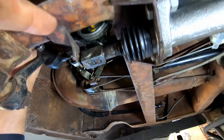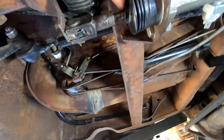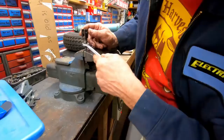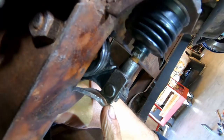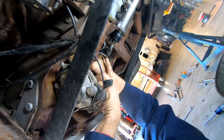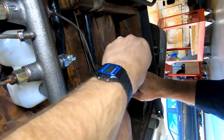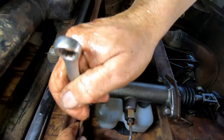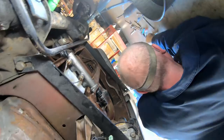We ran into a little problem with the brake rod — there's a little too much play before it engages the master cylinder. You can adjust this by backing off that nut and then turning the rod. We took the brake rod out and we're just going to spin that. They say an eighth of an inch, sixteenth of an inch — you just don't want it riding on there. What we're finding is the right front line is just a little far away; we pulled off the little bracket that holds the line, loosened the line, and pulled the whole line this way to where it can find its new location. Matt Jackson got a little bending — had to finagle with the yoke, which is something you gotta mess with anyhow. I'm pretty happy right now.